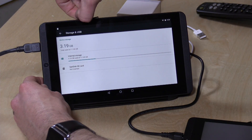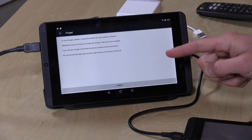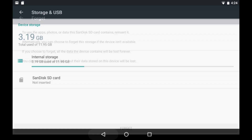You don't lose any functionality by enabling this feature — you really gain some functionality because you can still pop out the card, you just won't have access to the apps stored on it. One important thing to be very careful about: if you tap on the internal card while it's not inserted, you get an option to forget it. However, if you forget the card, even though the data is still on the card it will never work again on this tablet. So be careful not to click forget.